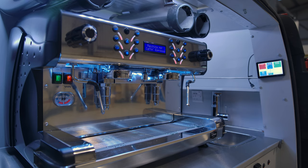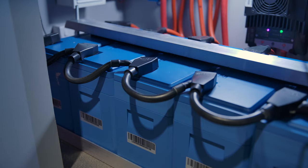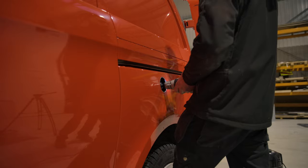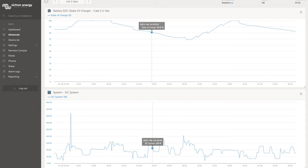This allows the franchisee to see the battery state of charge of the 12.8 kilowatt hours of lithium batteries, as well as in the future how much water is left in the tank. So far they've been blown away with how we've put these vans together and the level of equipment we've been using. As we go from van to van, if new technology from Victron comes out we try to use it where we can. The VRM and Bluetooth connectivity has really impressed me — it's so easy to diagnose a fault remotely because some of these vans go to Scotland and London. Rather than driving out, I can just log on to the VRM portal, look at the historic data, figure out what's going on, and even reprogram it remotely.